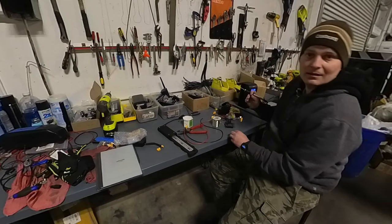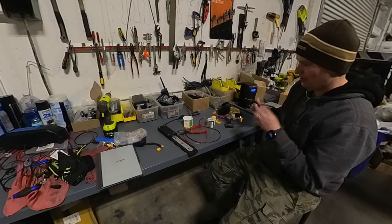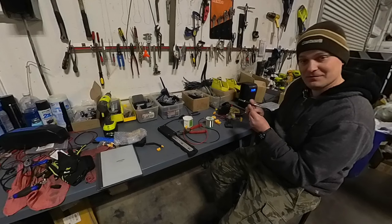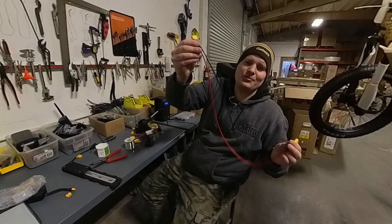Now I just need to put the XT60 on the opposite end of our extension. Luckily, all of these connectors — whether XT60 or XT90 — have a tiny engraving on the connector itself telling you which side is positive or negative, so just follow those and you'll be safe. There's our second connector. We have the extension: one end goes to the parallel connector, the other runs up to the rear rack for battery number three.